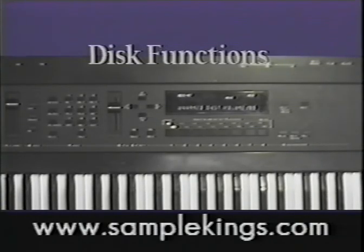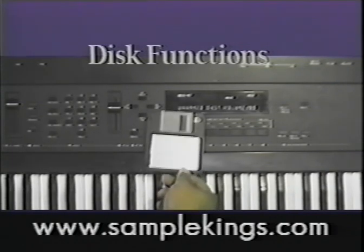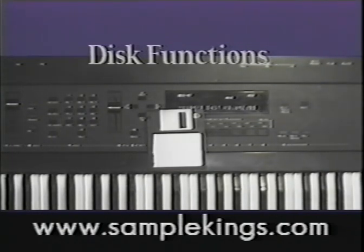Before a diskette can be used by the EPS to store data, a disk must first be formatted. Formatting puts information on the disk which the EPS uses to read and write files. In addition to formatting the blank disk, the format procedure can reformat a disk which has been used by another machine.